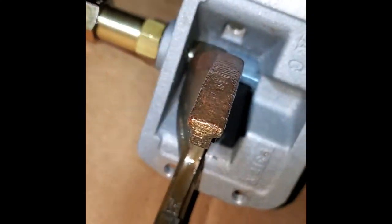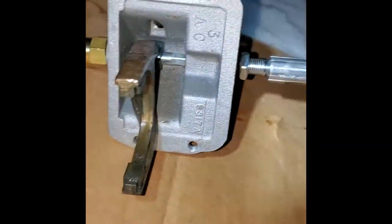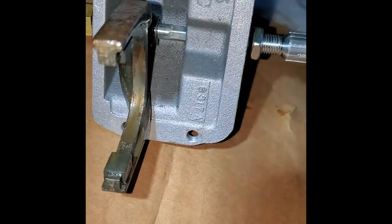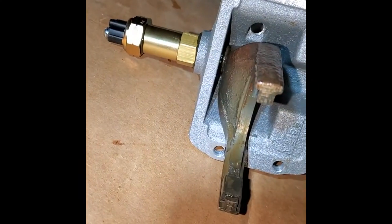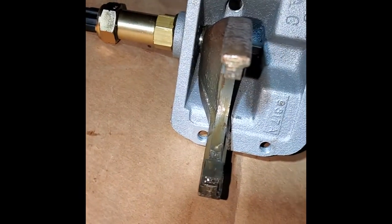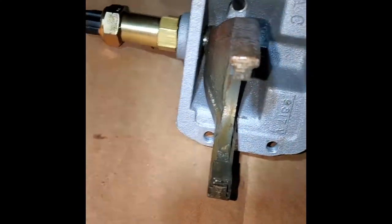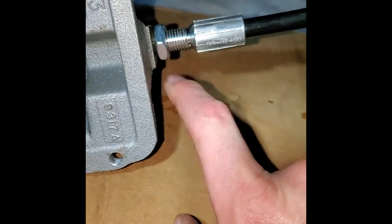I finally got that close enough to where I want it. I'm not super happy with how the adjustment works on these - it's got adjustment in two places, which makes it really hard. There's the adjustment of the cable casing inside the CAD housing, but then the knob up in the cab also has threaded adjustment for some reason. I've got it so that the outer snap ring is making contact like it says, but the only way to get it to activate the switch to turn off the 4x4 light is to thread the knob in the cab - it won't go far enough otherwise. I guess if I ever get the light hooked up that'll be figured out at that point.